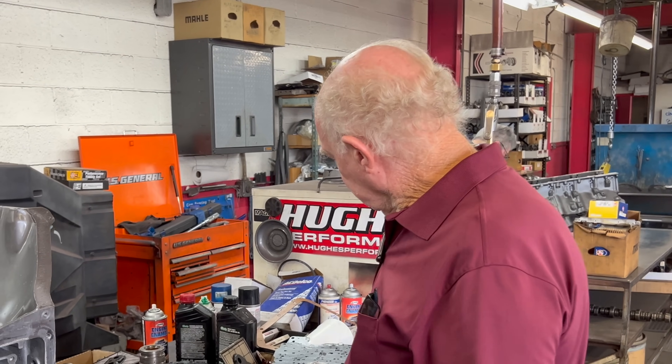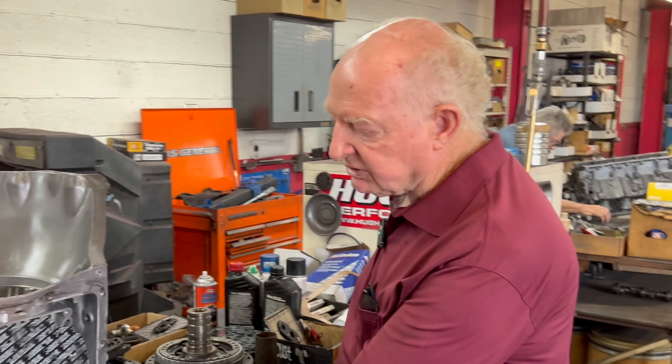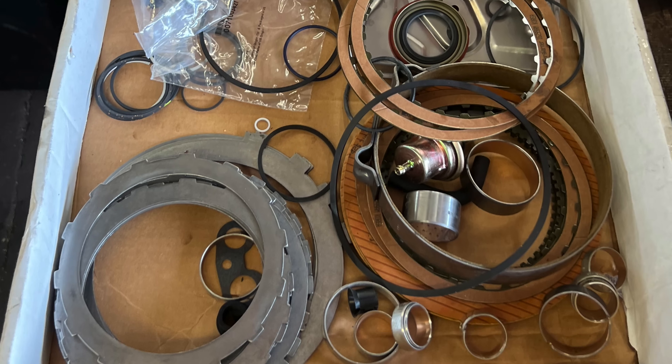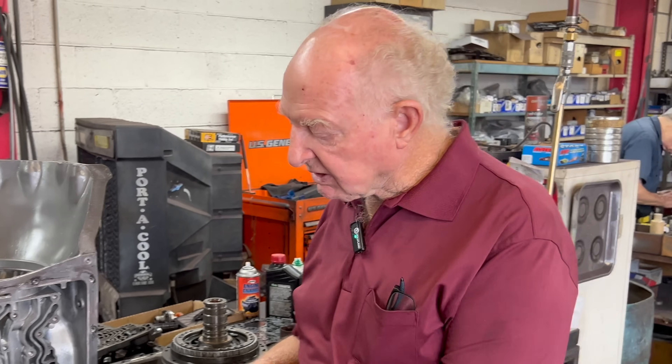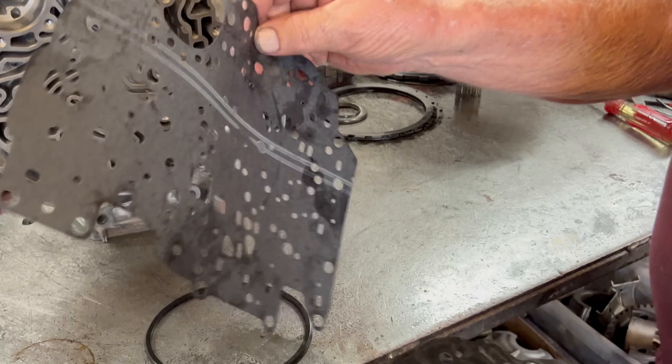There are normally four clutches in it, sometimes three. We always save the old gasket we take out of the transmission, because that's what was in it before. This guy had bought a master rebuild kit, so I got the gaskets out of the kit for this transmission — and they don't match! I've never seen gaskets like this in my whole life; the holes don't match up. You always have to look and make sure all the holes line up. This gasket here has a whole ear missing — it doesn't even come close. It's like gaskets for the wrong transmission. Brand new gaskets in this kit that I'm not gonna use — I'll go buy other gaskets. You have to be careful with that every time.